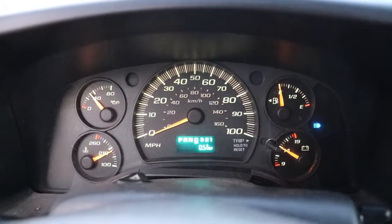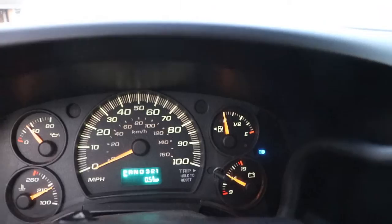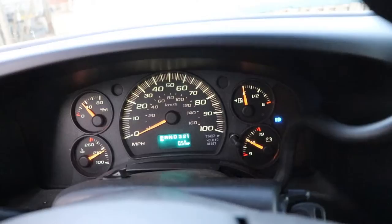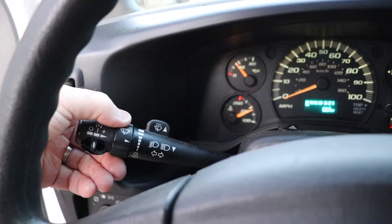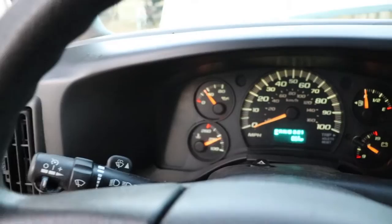If you're going in the mountains you'll have to put it in third gear as opposed to drive with the tow haul — it's a bit weird and cost me a set of brakes and nearly killed me learning that, so be aware of that. I own too many vehicles and can't remember how to turn off the high beams on this thing — on this one you flip forward; some you push backwards. Obviously do all this before you go on the road to remind yourself how it works. That's the intermittent wipers, and that's your cruise control — that always baffles me going down the road.